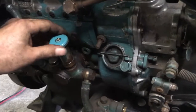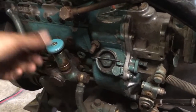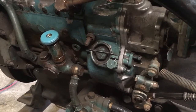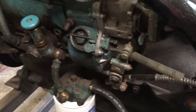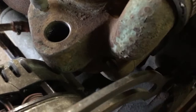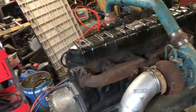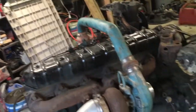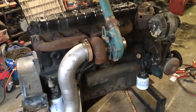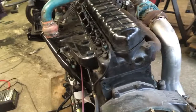Here's the little primer knob that doesn't do much — it seems like that might need rebuilt too. I may just go ahead and say screw it, I'm gonna in-frame it and call it a day. Why I'm suspecting a head gasket is that there's supposed to be a coolant port there and there's a little bit of smoke coming out of it. Either way, it's out of the truck now so it'd be easy to do. I'll probably tear the top end apart tomorrow and see what I can find. Sorry to disappoint, but you can only do so much. We're gonna get her freshened up and see what else we can come up with.